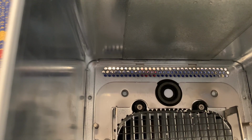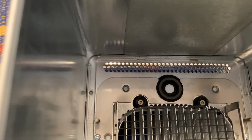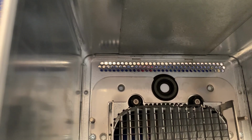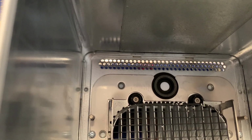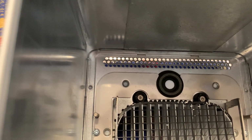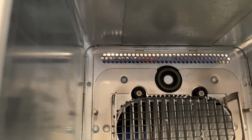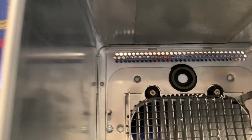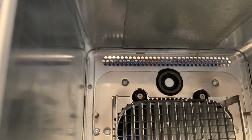In fact, one suggestion basically was to just cover up the button with electrical tape. Of course, then the button becomes non-functional, but you should still be able to turn on the computer with the button on the Apple Cinema display. Or if you used an older computer, you could simply use the power button that is on that keyboard, an older keyboard, I should say, one of the original iMac G3 keyboards. They all have power buttons on them. They plug in via USB, and you should be able to turn the computer on using that. Now, one suggestion I read, though, was to take out the gasket, turn it over, and put it in upside down.